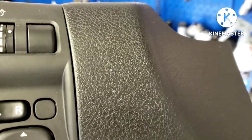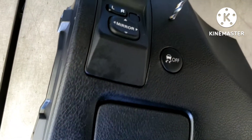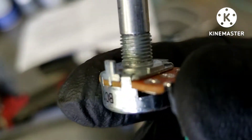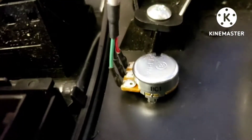I want the knob on the bottom so it's a little more out of the way, and the LED on top. I put a little divot where I want them. It fits in there — almost like a glove — but I need to go a little bigger so the threaded end will fit, because the threads need to protrude to the outside. There's also a little tab that sticks up that stops it from spinning when you turn the knob, so I need to make a second hole for that. I drilled a 1/8-inch hole — the smallest I had — and it worked out perfectly.